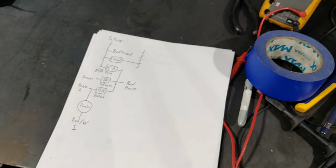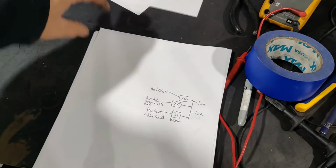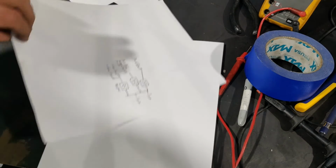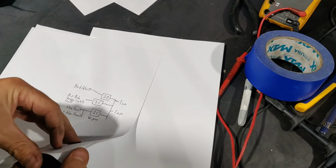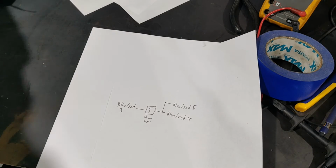When I was done, I had 4 wiring diagrams for the 4 circuits in the fuse box. One circuit is always on. Another is the accessory circuit. The third is only on when the key is in the on position. And the fourth was a 3-wire circuit that just provided a fuse for the instrument lights.